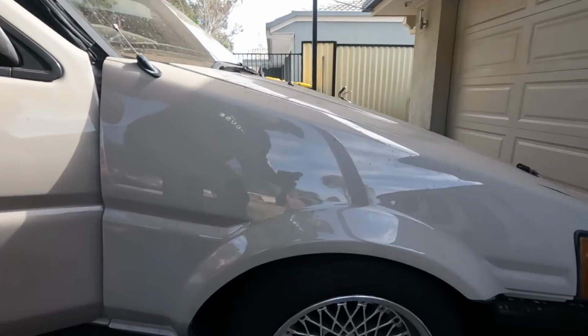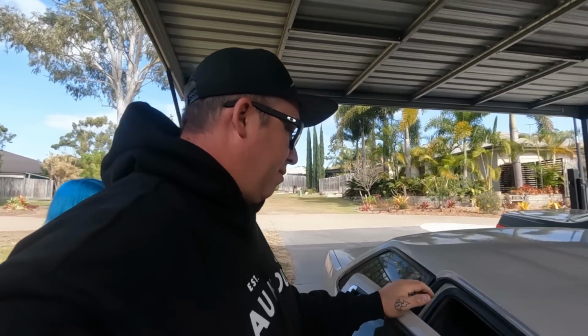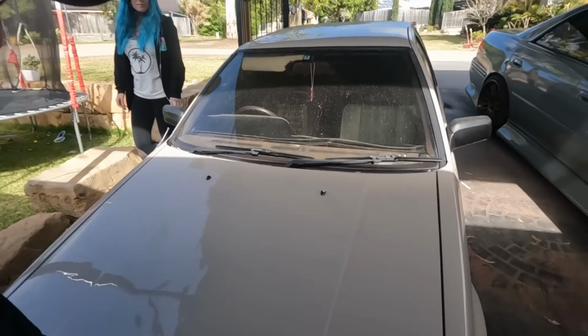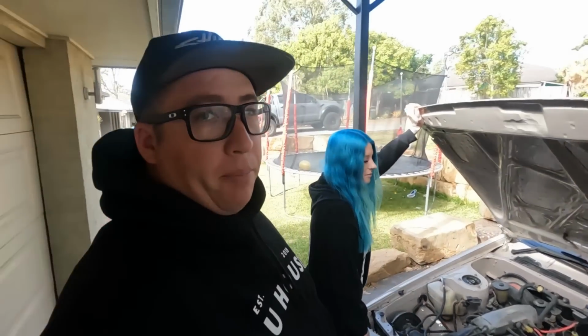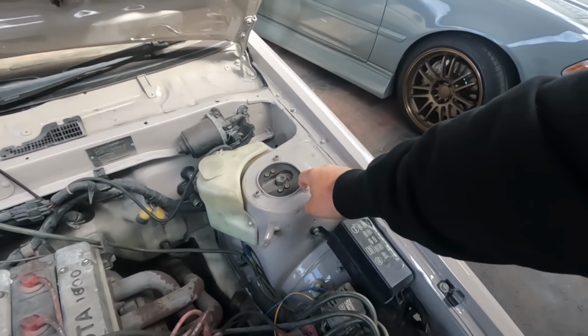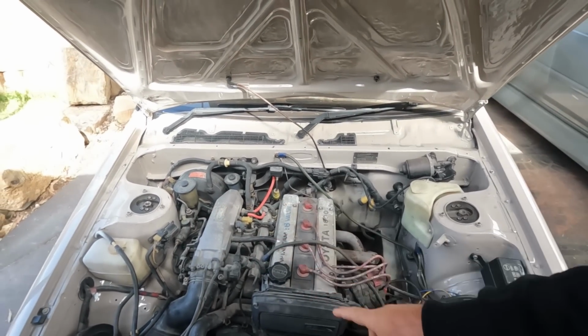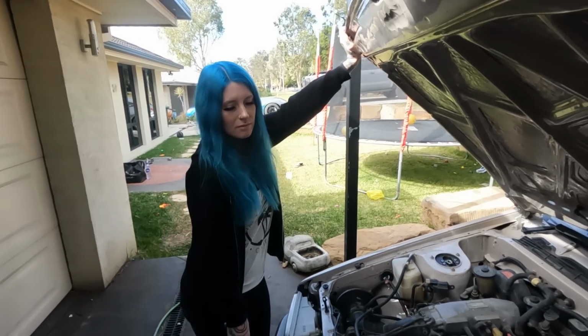I don't know if you can see. So, FC RX7 front brakes. It's got a half cage, a Capacity half cage in it. Ideally, I'd like to get the front half, so if anyone has a front half AE86 roll cage for sale, definitely let me know. We're interested. I feel like the brakes are going to be good enough. I want to put a strut brace back in this. I've hit up the boys at Shockworks to get longer bolts so we can put the strut brace back on. The stock radiator should, in theory, be up to the task for grip driving.